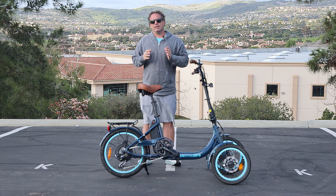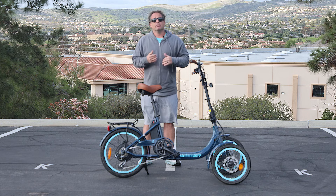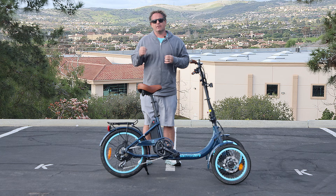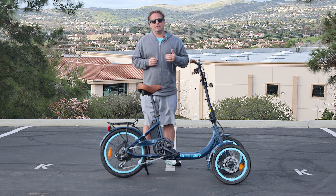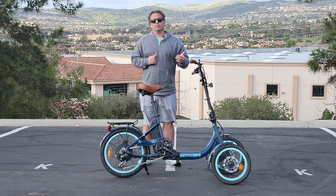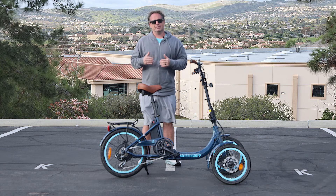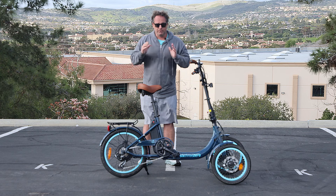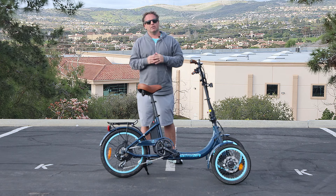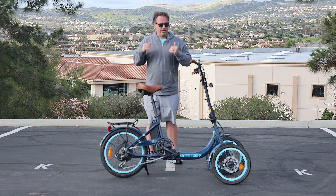You've got a 10.4 amp hour battery, which is going to give you range of up to 50 miles. The 50 mile range is dependent on the weight of the rider, the terrain you're riding, and also the combination of throttle and pedal assist that you use. If you use more throttle, you drain the battery quicker. If you use lower levels of pedal assist, you can extend the range further. You can see on our website we have a gauge and range of expected range out of the battery.